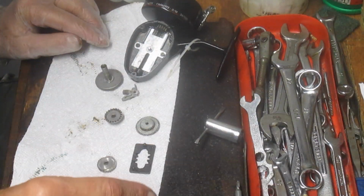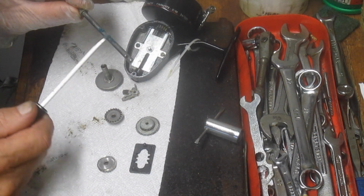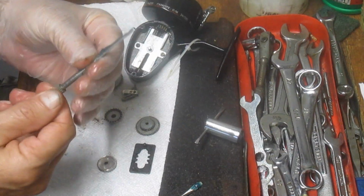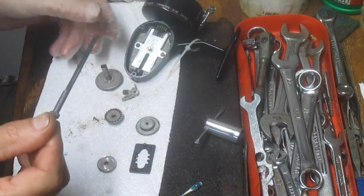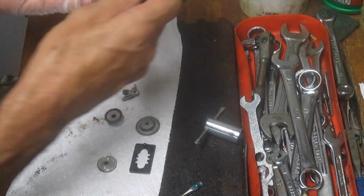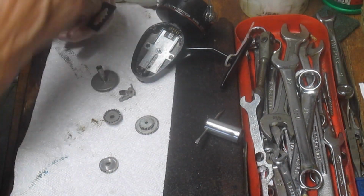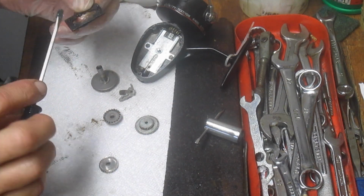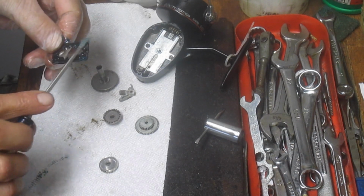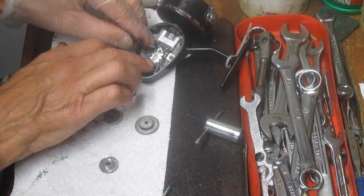Next up then is the axle shaft, which has been cleaned. We want to make sure we get some lube on that. So I like to just put some of the real grease on here, and then I use my gloved hand to kind of spread it around, giving it a nice even set. This goes flat side down as such, and then you want to grab the slide mechanism here. I'm sure there's fancy names for them. I don't know the names. There's a hole in the axle shaft where that stud sits.